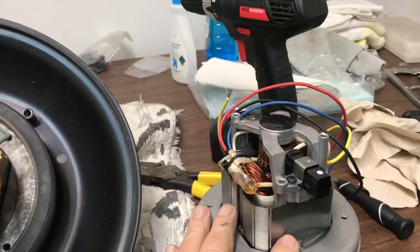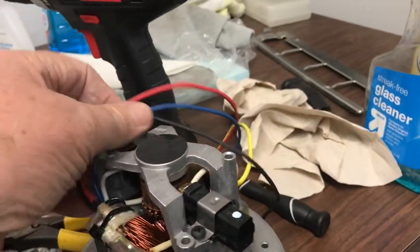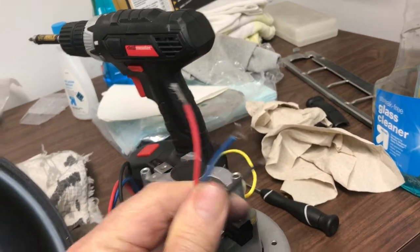We have to make sure the wires go out on the left and the arrow is in the back. Here's the new motor — it has twist-on wire nut connections. That is the heat sensor; the heat sensor shuts the motor off automatically when it overheats so you don't burn up the bearings. When the bearings are that old — this machine is probably 25 years old — that's how this happens.